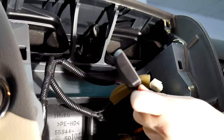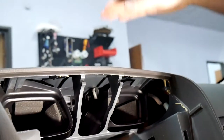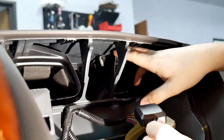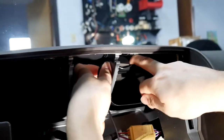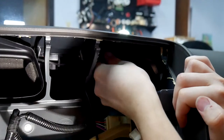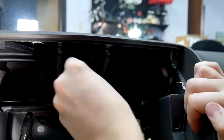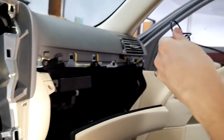The way I like to put the GPS antenna is right here — there's plenty of room for it to go straight up without any interference other than a little bit of plastic and glass, which won't really affect it. You just want to stay away from metal mainly. I'm going to pull down on this vent just a little bit and slide it up in here. Once you get over that hump it's not too bad, then push it back a little bit. Now we've got our GPS antenna right there — it's a little tight which actually works out better, kind of holds it in place with the 3M tape as well as the pressure itself. Then we're going to run our cable down.